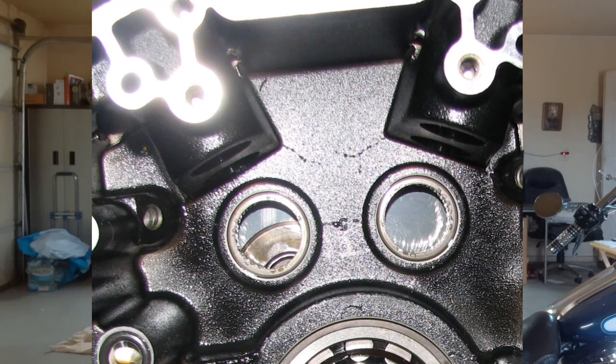The way to avoid that is with these old cam plates that had the spring-loaded chain tensioners — you have to change those every 15,000 to 20,000 miles. When you pull everything out, you need to inspect the cam bearings that are inside the case — the inner cam bearings and their needle bearings. You take your finger, you run them around, you see if there's any drag, or if any of them look misaligned or cockeyed. If they are, you need to pull those out, because when they go, they will destroy your motor. Those are the only bearings I've seen go bad over 15 to 20 years of working on these twin cams.